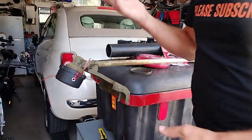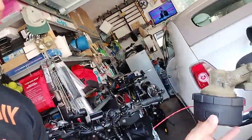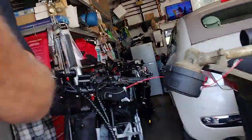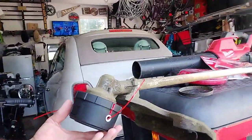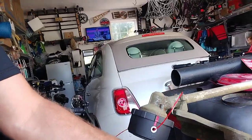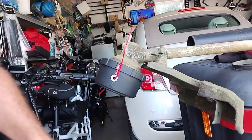Easy feed — done. You don't ever have to take it apart like the old ones where you had to push two little buttons, pull it out, manually feed it, and try to get the line back through the grommet holes. That's the old style. Milwaukee has come up with this beautiful system — and a lot of other manufacturers are doing it now too — but just line those holes up, stick it completely through, manually wind it back in till you get the right length, and the metal cutter will trim it so it doesn't get too far. Easy feed — super nice; it'll save you so much time.